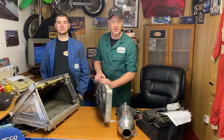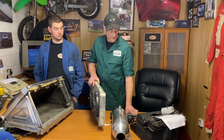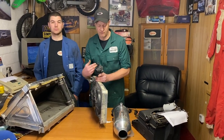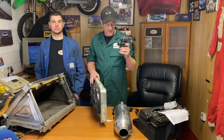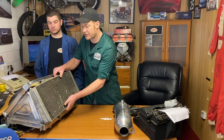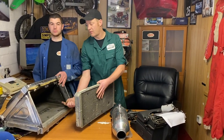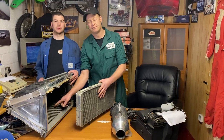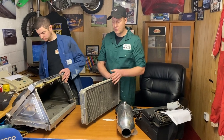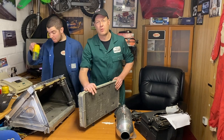These fans, the minute the engine was running and the pump was activated, ran full time, all the time, cooling. Now, when you put this in here and turn it into a sealed box, whatever's dragged in through here has to go out through here. It's got no other choice. Can't go anywhere else. So we have constant cooling, even stationary, of the charge cooler.